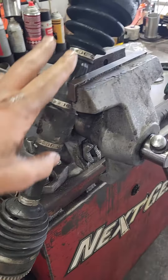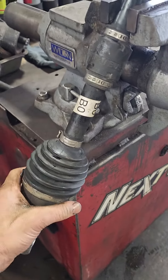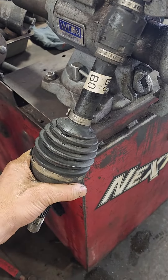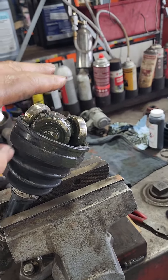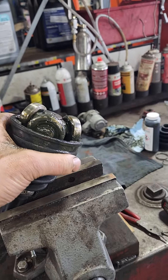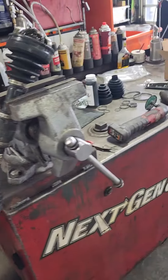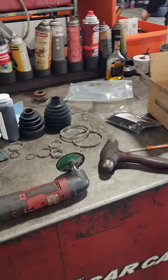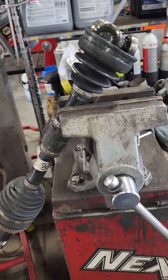What they want you to do is replace the inner with the outer, because to take the outer off you end up doing damage to the axle. These never come off the way they should, so you don't touch that. You can leave the inner half shaft on the car and just pull it out, then put it back together on the vehicle and clamp it. Toyota does sell the kit for these Camrys, which is nice — no need to put a cheap axle on it.